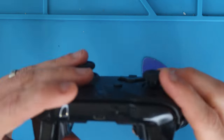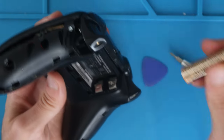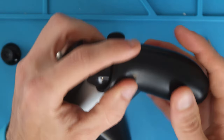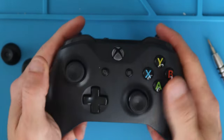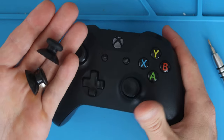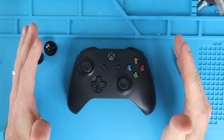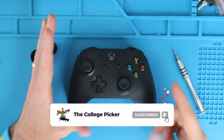Grab your controller case, place it back on, turn it over, and reinstall the five screws — don't forget that secret screw underneath the sticker. Then put your batteries back in, replace the battery case, grab your side panels, line them up, press them in, and everything should pop right back into place. Your controller is good as new — these XB1 replacement sticks are very close to OEM and feel great. If you have any questions, drop them in the comments. Please give the video a thumbs up, subscribe for more projects, and I'll talk to you in the next video!